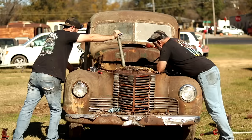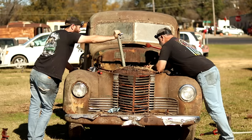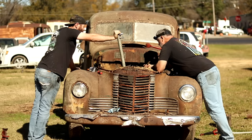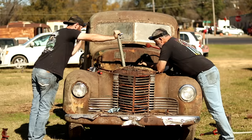When we started, I'm afraid we're going to end up having to pull that pan and just check it from the bottom side to see. At least that way we'll know which way they're going as we're turning it. You know, you'll know which ones are going up, which ones are on their way down. You might just have to pull them loose from the crank and try to hammer up the rods and pistons up through the cylinders. Or if we can break one loose that we know is locked up and turn it, maybe hammer it down that way. Right.